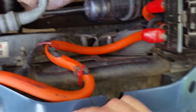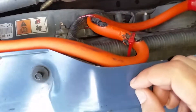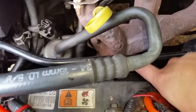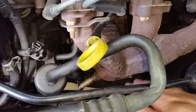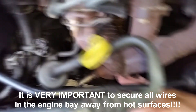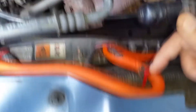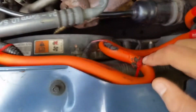Originally, I had this kind of stuffed up in here a little bit. This wire is a little stiff, and what happened over time, it fell out down in here. Whenever I was riding or whatever, it would bump up against the exhaust manifold right here. I got really lucky that I didn't catch anything on fire. That looks kind of ugly — I'm going to eventually cut it down when I get some more ring terminals.